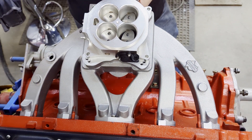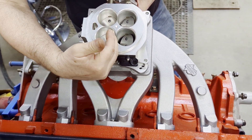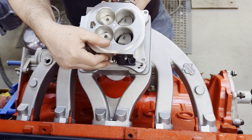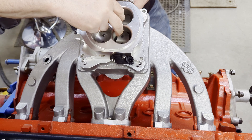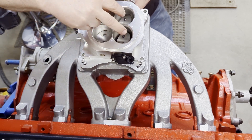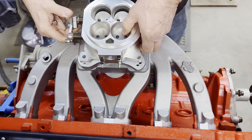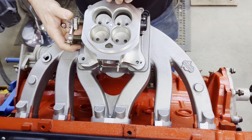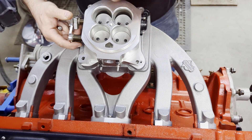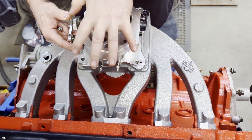It's not as bad with fuel injection where this throttle body is just handling air, but on a wet top manifold where you have throttle body injection with fuel injected right here, or a carburetor where the fuel is right here, you're going to get your best distribution with this orientation — it's equal, it's primary, and it gives the longer runner length like we said.